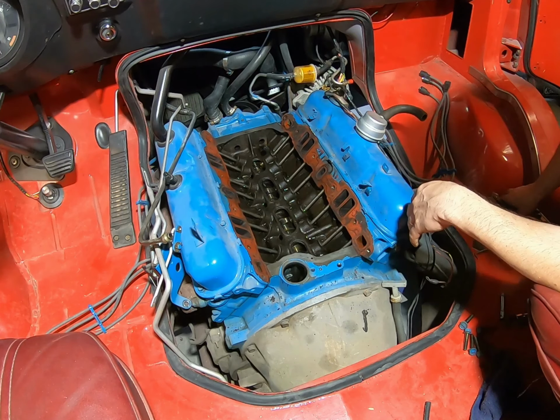I also make sure to, since you can see all the push rods here, to give it a little crank and see if they all move up and down evenly, and they do. There's no dead cylinders or dead wiped out cam lobe action there. So I did put a little black mark on each one with a marker, and you can see it move a lot easier.